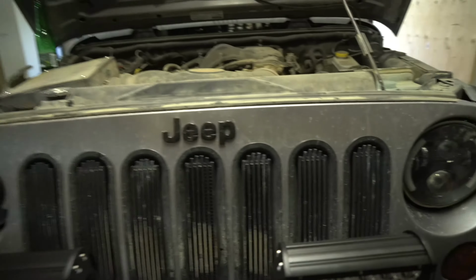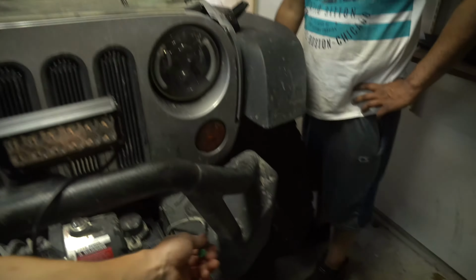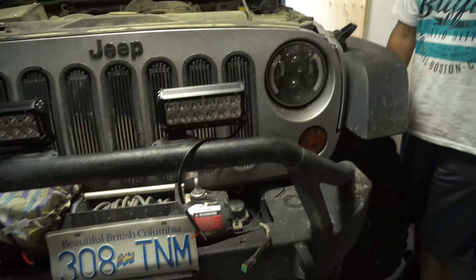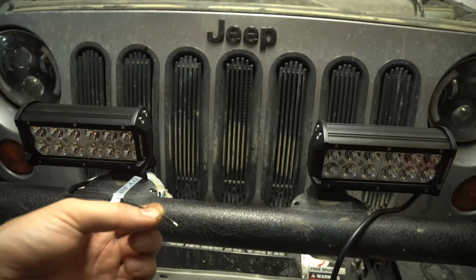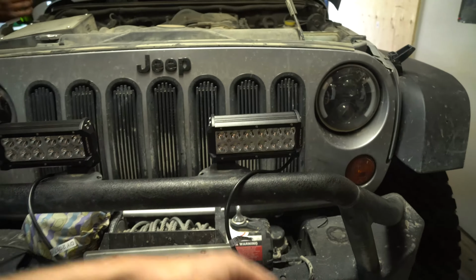But the next thing I'm going to do is we're actually going to reuse those plugs because we have ready access to these quick disconnects. So again, these are made by Rigid, so if you want quick disconnects on your light bars, you can either go pick that up or look for your own waterproof connector. So the next thing I'm going to do is solder on those quick disconnects so we can plug them in. And after we do that, then I can clean up the wire.